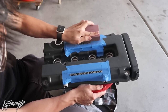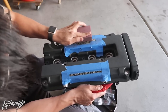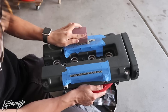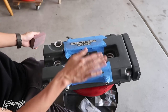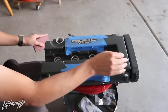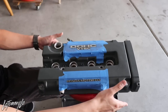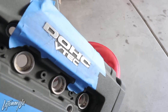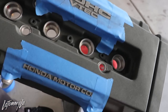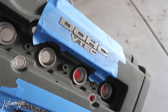This block is 320 grit. I would do 200 grit to get it done faster, but 320 grit has been doing fine — I've used this block on like three other valve covers including mine. Since this valve cover is pretty old, it does have pits in it — you can see the paint is getting into the pits. But it looks a lot better than before. That side I haven't sanded yet; this portion I already did.